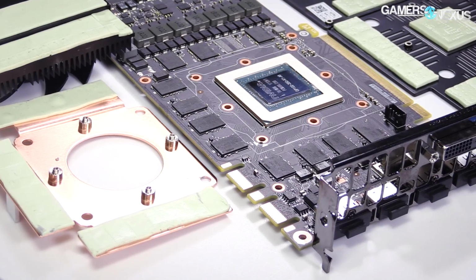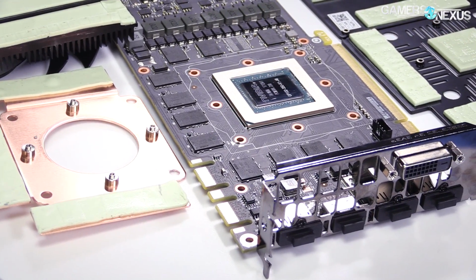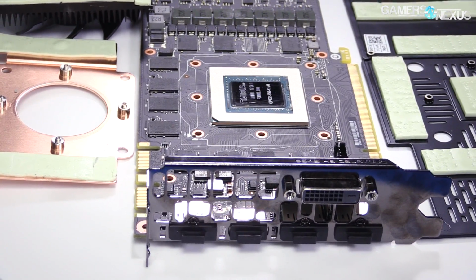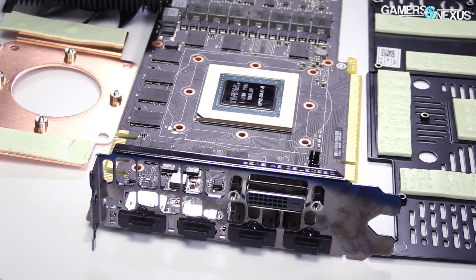And then further, our testing measurements, the averaging for the numbers that you see in the bar charts, not the over time charts, is done at steady state. So that's once the GPU has stopped fluctuating, at least within reason. Because of the way we're working with the modifier now, not all values are going to be a hard delta T over ambient, but some of them are. If they are, we'll mention it and the chart will say so.